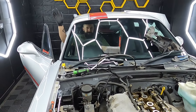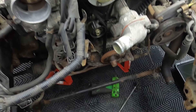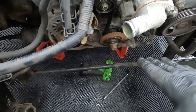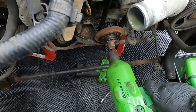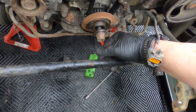Now comes arguably the most difficult part of the timing belt job — everything else is fairly simple compared to this, and that is to remove the bottom crank pulley bolt. These can be really tight, and the easiest way to do this is to get someone in the car stomping on the brake pedal, make sure it's in fifth gear, clutch up, handbrake on, just so the engine doesn't turn. Then hang on it with a breaker bar and socket.